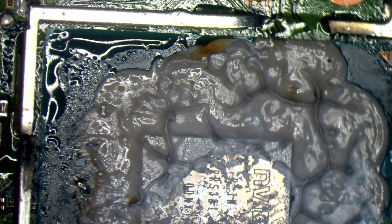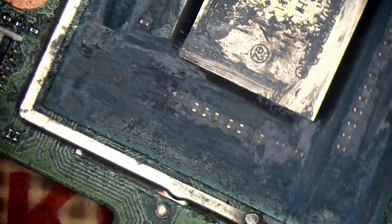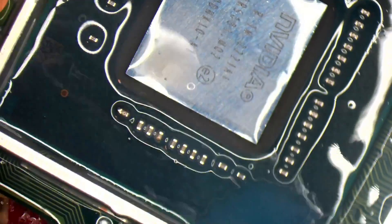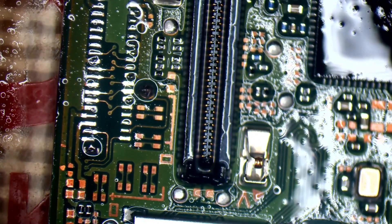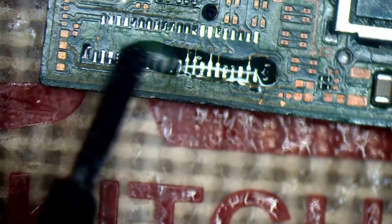The shield's going to have to come off because I'll end up with isopropyl alcohol all over the CPU. I need to clean the thermal paste off and replace it afterwards because flux will find its way underneath and onto the top of the CPU no matter what - plus it stops everything gunking up across the rest of the board. Was I missing a pull-down resistor on the other board? I might need to look into that. Right, that's a bit better. We're all fluxed up.